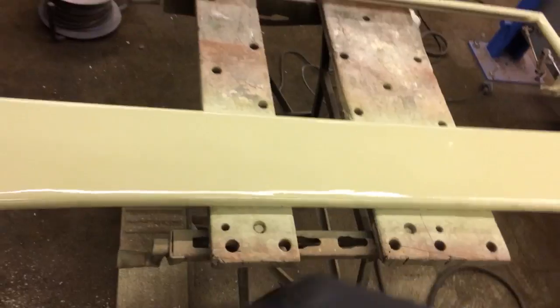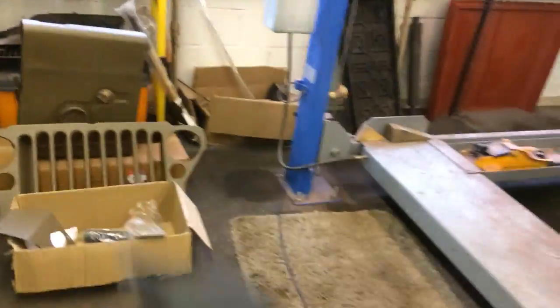like that, green, which came from the factory like that, and I just put the coat on it because it's perfect. But that one is all knackered and full of dents, so first you have to get the rust out of it, weld whatever needs welding, then flatten it off, then rust proof it, then fill it, then spray fill it, and keep rubbing it down every time, and then spray green like that. So once that's done, we can join it with this, which is the glass that we put in, and that's ready to go on the Jeep. So yeah, long work.